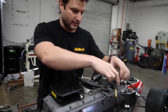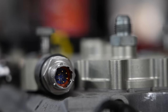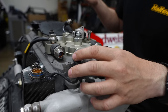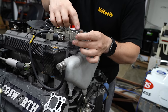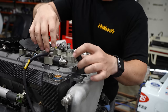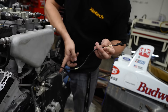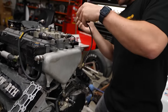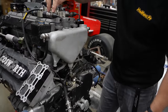Let's build off that. These are sensors, and they have names on them. Looking at the back of a sensor connector — six pins again. I figured these were pressure and temperature: pressure sensors need three wires, temp sensors need two, so five total. But when I traced the wires, only the first four connected to anything — the other two weren't connected. That started making me think: that's a water sensor. The temp sensor just has a five-pin connector, which was confusing, but connecting them confirmed — one is a temperature sensor, one is a pressure sensor.